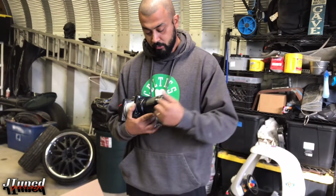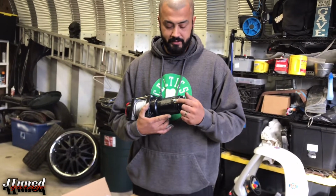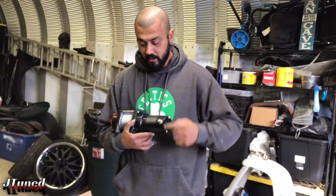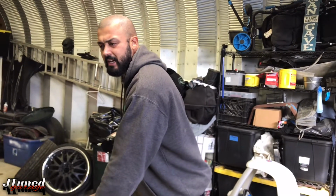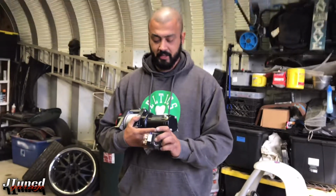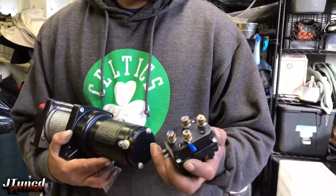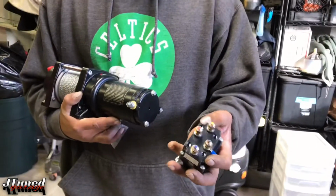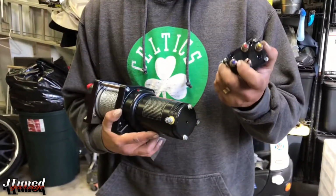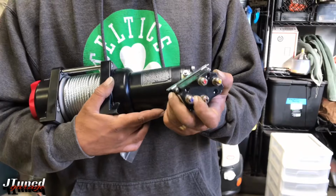And then after I put these wires onto this, I got some liquid tape, like the black electrical tape. We'll put the liquid tape around this. And instead of spray painting it, I'll probably just use the liquid tape for these two connectors after I get them all tightened up, so that way it protects it from any weathering. Same thing with these Phillips screws, because they were all rusted to crap. I'm pretty sure this is a ground, so I'll ground this to the body.